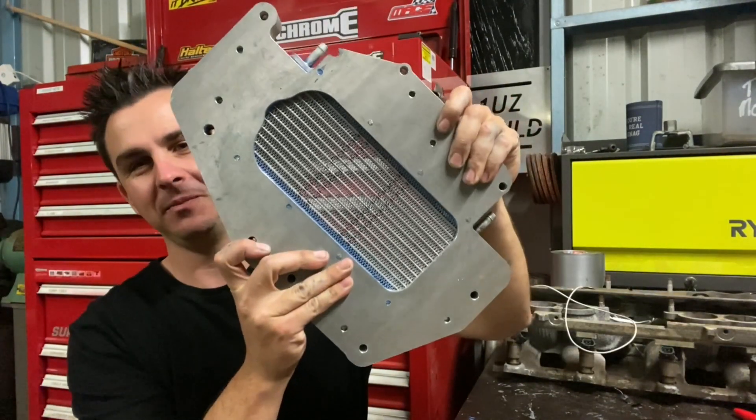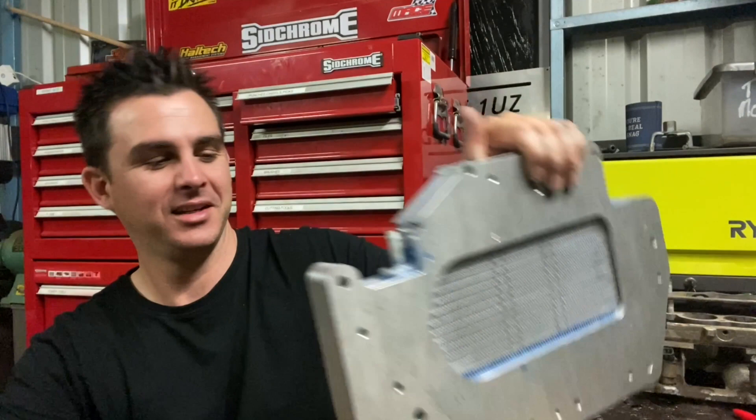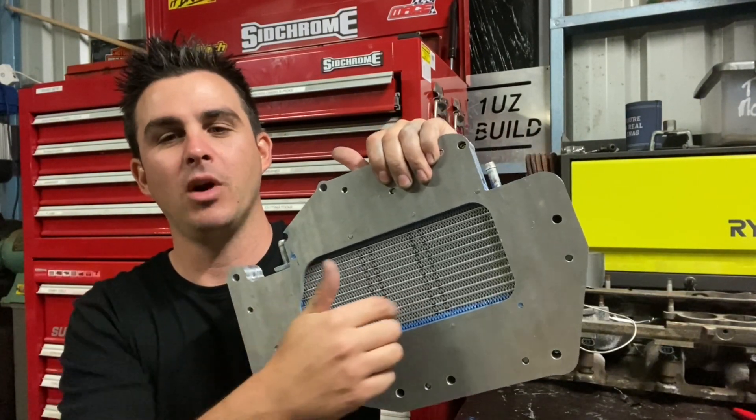So if you made it this far through the video, thanks for watching, I really appreciate it. And you are rewarded with seeing one finished intercooled sandwich plate - pretty cool. I'm glad that we're able to wrap this all up in one video. Seemed to be doing a lot of videos lately talking about stuff and not actually getting it done, and we finally achieved something. There was a lot of RTV that squeezed out as this was being assembled. I sat down for about half an hour off camera just with a rag and prep sole trying to get all these little bits as they were squeezing out, and there was a little bit around the inside I was trying to wipe out. Once that goes off it'll be easy to pick out and blow with a compressor to make sure there's no debris in there.